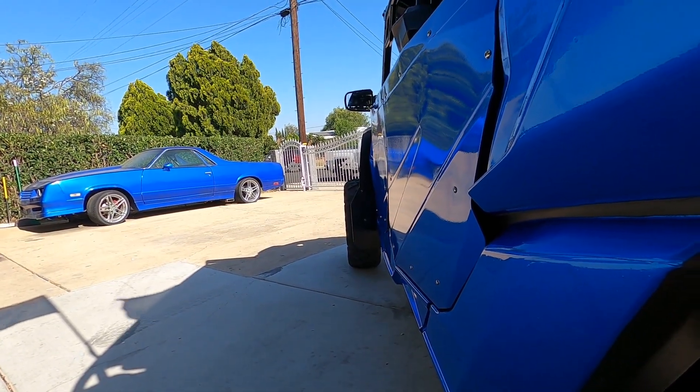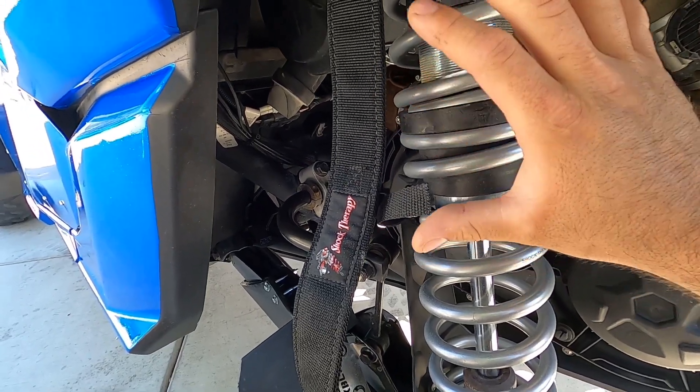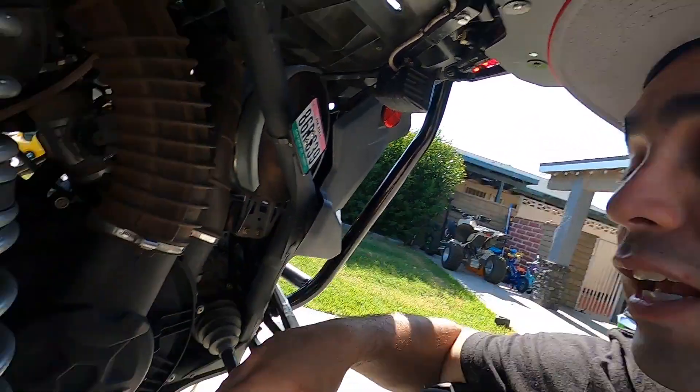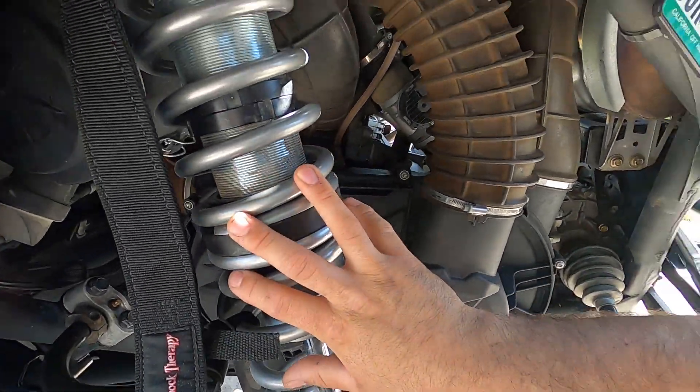The front shock straps are a must-have. The rear shock straps, on the other hand, Justin from Shock Therapy says are not needed if you're keeping the stock wheels and tires — the shocks have enough damping. If you run 32s or heavier aftermarket wheels, or heavier aftermarket rear suspension, then you might want the rear straps to save the CVs and axles and avoid clunks. But the fronts are absolutely a must-have even bone stock from the dealer.